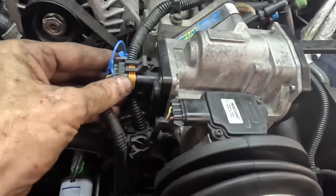Ah, look at this. This is interesting. We can see the separation of the new oil versus the old oil in this. Look. See when I hold the light behind it? That's the new oil that we dumped in. It also might be some of the brake clean, but you can see a clear separation between the two fluids. Let's hang back and let this thing drain for a few minutes. Then we'll come back in, refill the system, change the filter, and restart the engine.